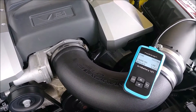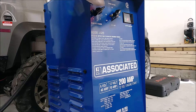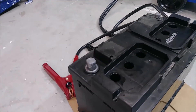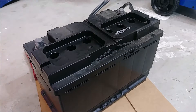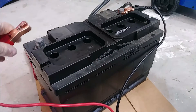Here's what we've got going on: this big machine with 200 amps. The technique is to put it on 12-volt start for 15 minutes, attach it to your battery with the caps off. It's going to start boiling once you give it power — don't worry, it won't explode because any pressure escapes through the holes. As it boils it should be cleaning those plates off, evaporating any buildup and giving us a decent reading.